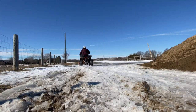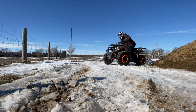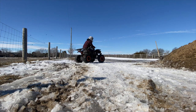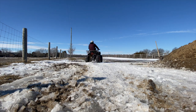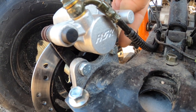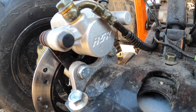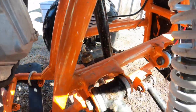Now we'll move on to all the problems I've had with this thing. A lot of these problems can be blamed on whoever put it together. I did not buy this ATV — it came when I bought my house as part of the deal. At about 150 miles I go to hit the rear brake and there's no rear brake whatsoever. The caliper was just hanging over the axle — both caliper bolts had backed completely out and fallen out during riding. Luckily the piston didn't come out, so I just threw two new bolts in and away I go.